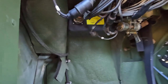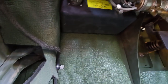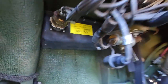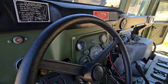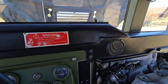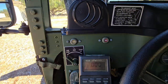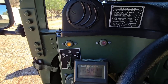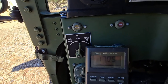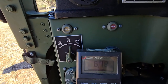I've installed one of the older black ones with no sensor diagnostic port — this is the older style. We'll see how it operates. Zero volts initially. It's got the wait light, it's got voltage. These older ones will bounce — you can see the voltage is bouncing. It goes off then on, off then on — it kind of goes through this phase. It's not a cold shutoff, it will bounce. It goes back to six volts.